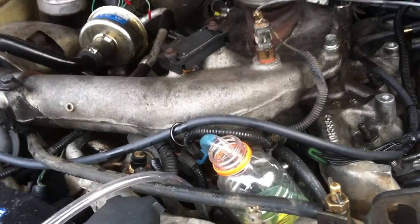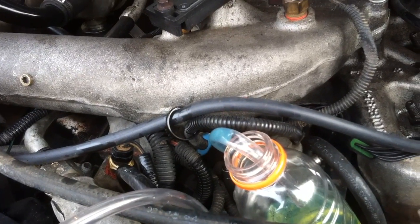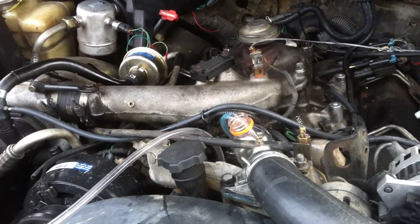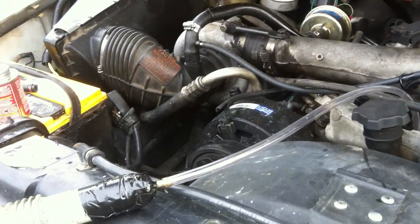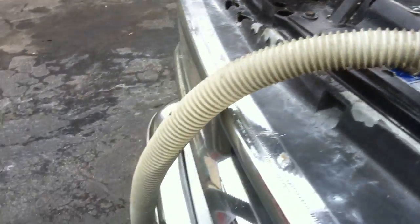I ran some clear tubing on there — you can see I've got one piece going into the bottle, which was disconnected. That comes from the DB2 pump. It's pumping fine, no air bubbles in the system from that part going out into the fuel return. So I suspected maybe the fuel return was blocked or restricted, and I decided to run this.